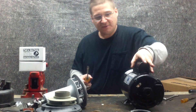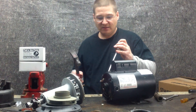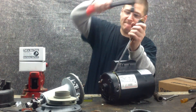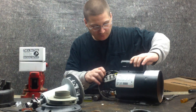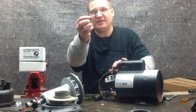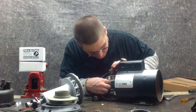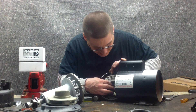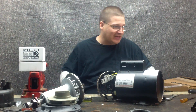We're going to move that stuff out of the way and pop open this rear end bell real quick. I'm going to take a flathead screwdriver and pop open this rear end bell just like this. Inside my rear end bell there is supposed to be a bearing spacer, and here it is. A bearing spacer is back there. So you always want to make sure you have your bearing spacer — a lot of guys don't check that out. They're always afraid to open the rear end bell. I like to always open the rear end bell. Now that is one bearing spacer.